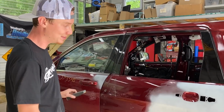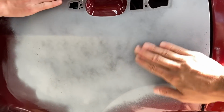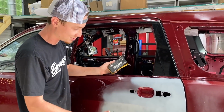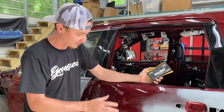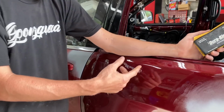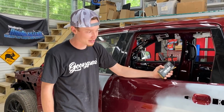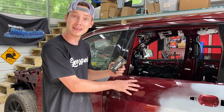I believe we got a few more on this side. We're gonna jump on the next biggest one, is this door over here. Try to get this nice and straight. And this stuff does sand out pretty quick, don't it? Yeah, we're using a 500 grit. That's just gonna make it nice and smooth for the paint to actually stick. And it sands out quick with the 400, 500, whatever you want to use. But for the doors and stuff, the 600, usually original paint takes way longer because they use some kind of weird clear coat that's super tough. Or they run it through the oven or something, yeah, and they bake it. Yeah, they bake that sucker like crazy. But anyways, we're just going to keep on moving with this primer, try to get it all knocked out, and then jump on the paint.